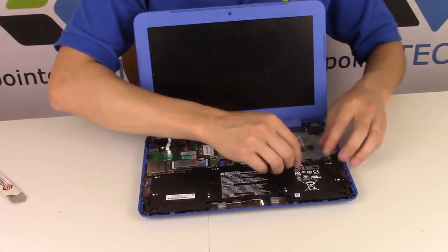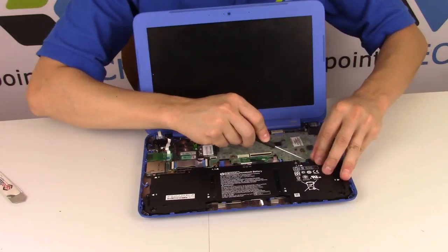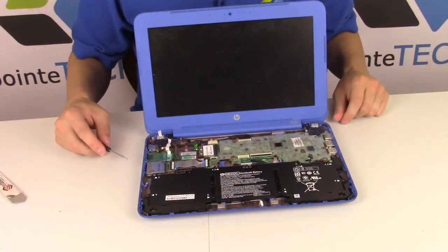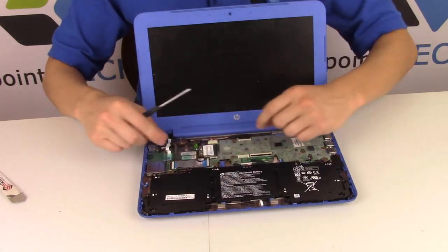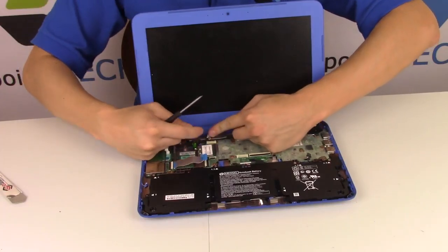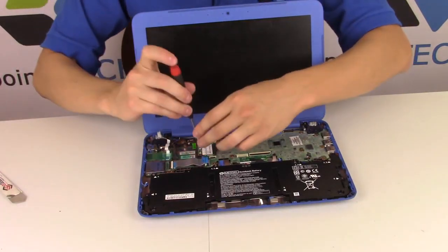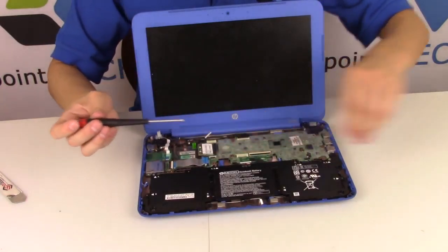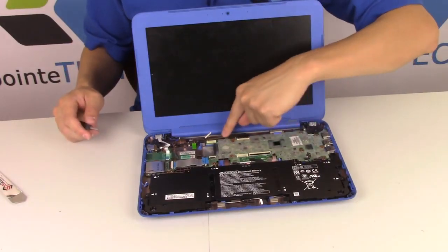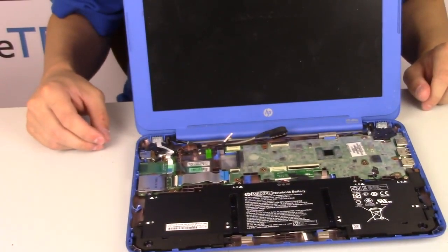This looks like it's your speaker wire in here — let's go ahead and unplug this. Get a little bit there, a little bit there. There we go — unplug that. You have your card slot there connected to the board: put that pin up and pull it out. We've also got your power jack — unplug that. Your wifi card is plugged in, so we're going to unplug the wifi card. Take out the wifi screw, slide the wifi card out. Your video cable comes in here and connects to your LCD — pull that pin up just like the other ones and slide it out. Alright, looks like we're fairly detached.